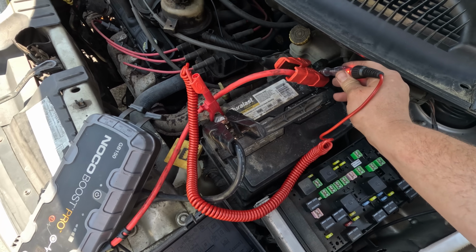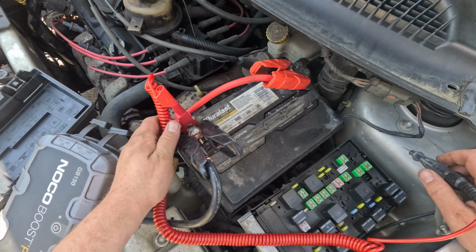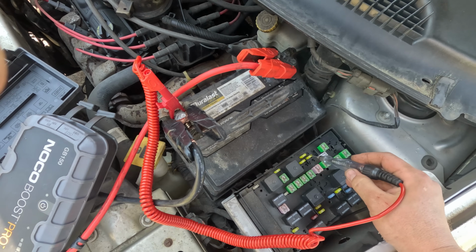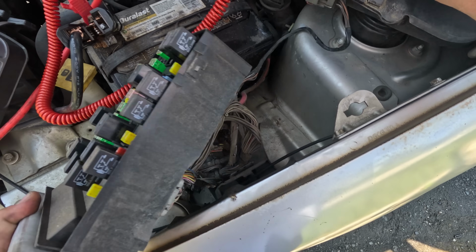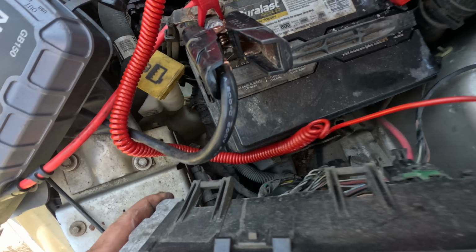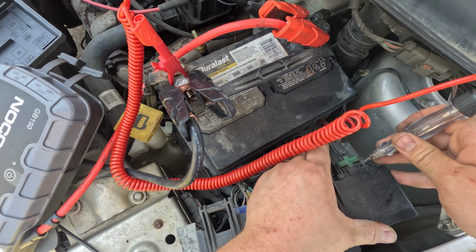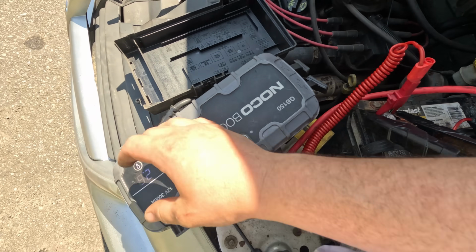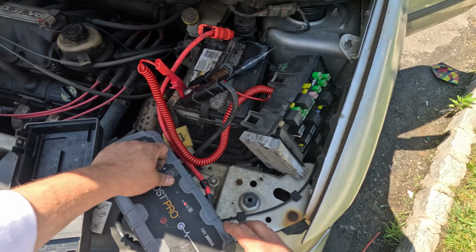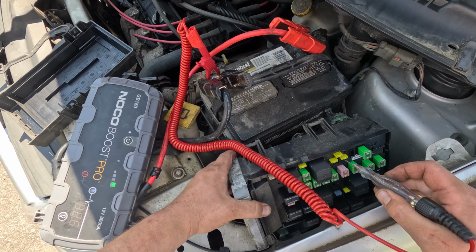See, but the test light looks dim. It almost looks like the whole car is not grounded properly. See, here it looks brighter than here, for sure. This comes right up. I hear stuff rattling in here. All right, well here's the power wire. Here it's bright, and here it's not. Let me turn the thing on. Now this is on, and it's still dim here.